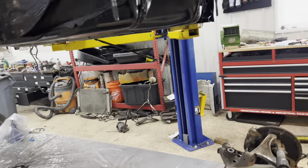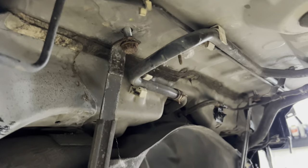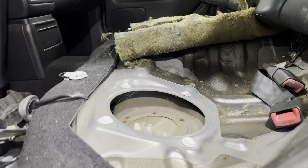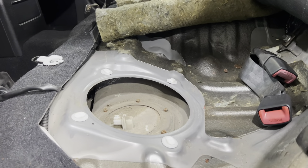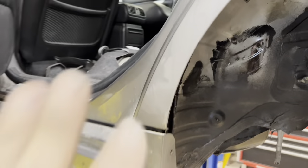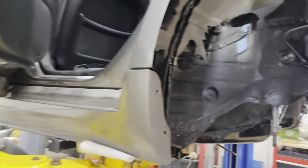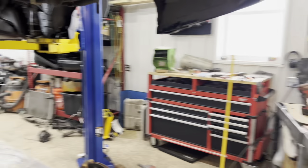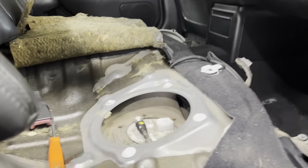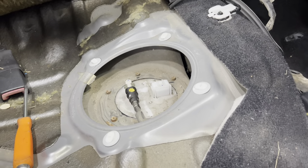Next step: I have the fuel tank dropped about an inch or so. These cars are the easiest cars in the world to do fuel pumps on. There are two clips for the seat, you send the seat belts through, there's a little cover with four screws — you turn them clockwise to unlock them. This one over here is the sender, which tells the dash how much fuel is in the car, and then the passenger side is the actual fuel pump — you can see the feed line coming up.